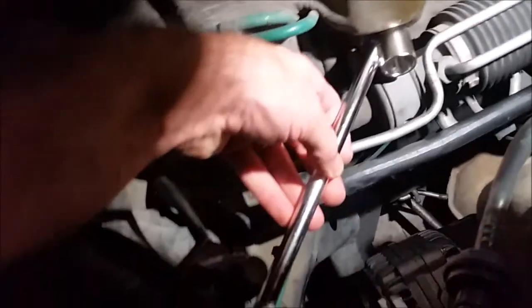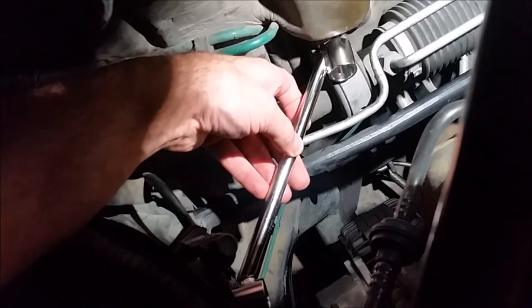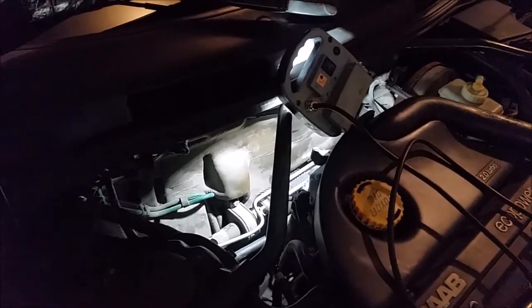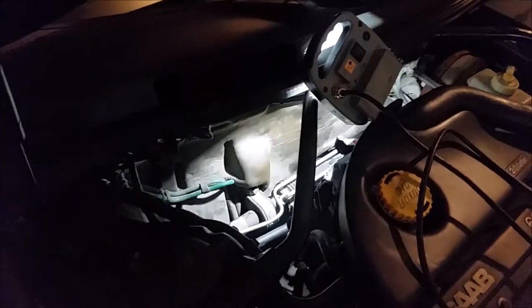And I'm going to show you real quick here. There's the brace, how this is going to go. Imagine the aluminum piece in here already. And so this would go just like that, pretty much like that, to stop this thing from moving around, from moving side to side. And it's going to stiffen up the steering and the handling quite a bit. You've seen these things, and it prevents firewall cracking. Hopefully your firewall is not cracked. If it's not cracked, then that's great. It's a problem on these Saabs. And so, yeah, you deal with it.